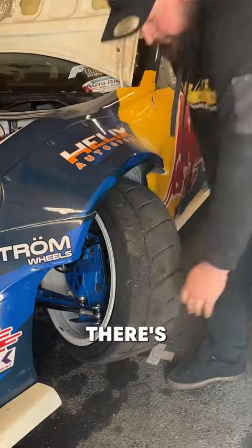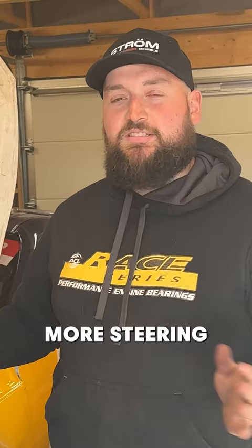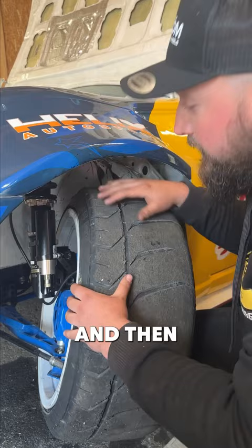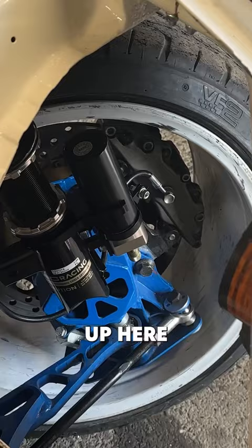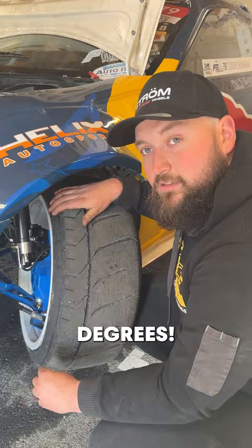See, there's quite a lot of lock. On a drift car, we obviously tend to go sideways, which means that you want to put a lot more steering angle in the car. They make this custom bottom arm which extends the bottom of the wheel, and then the shock top up here is custom also to bring the top of the shock out. And then you have super long track rods to extend out to where you want it to go. You can run it at like 75 to 80 degrees.